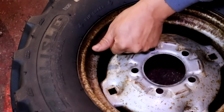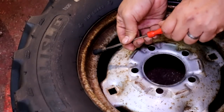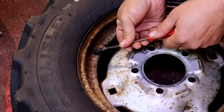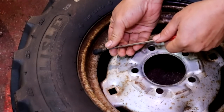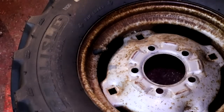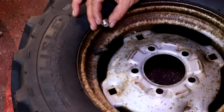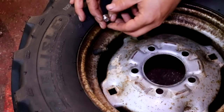Okay, now to get started you have to first remove the valve stem cap. Then using your valve stem tool, remove that core and let all the air out. I installed tire tubes into this tire, so this can only take six gallons. If you did not have a tube you could probably fit seven or eight gallons of liquid ballast. But I decided to use a tube — you can use whichever works best for you.